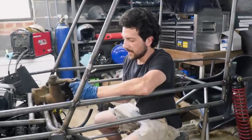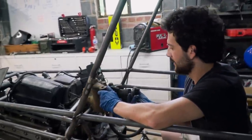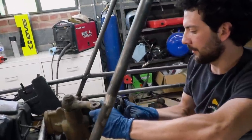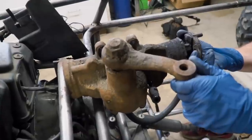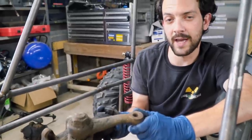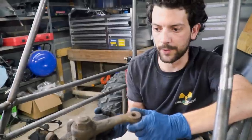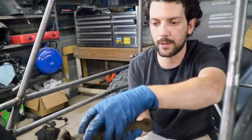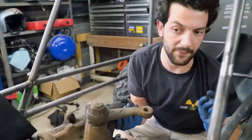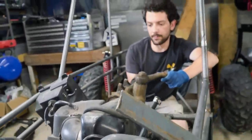What we've got here is a power steering box from an old Chevy. If I know Ike at all, it's going to be an old Chevy. We're thinking of mounting it right here and then basically mounting the steering wheel right to the end here. This puppy is three and a quarter turns from lock to lock. We're going to need a pitman arm puller, mount it so that center is right there, and we'll have a piece of linkage that goes through the frame up there attaching it to the front end. Should be pretty cool.